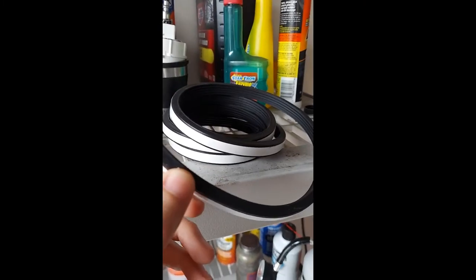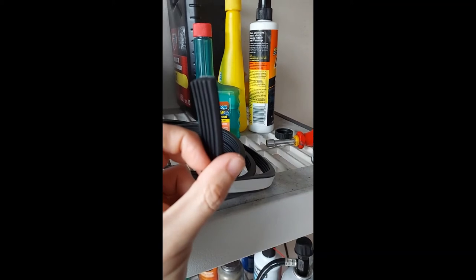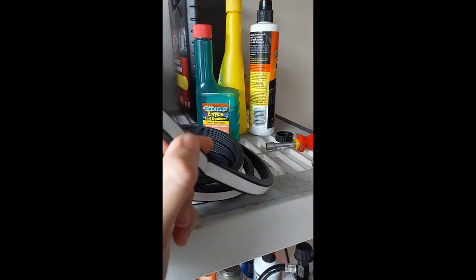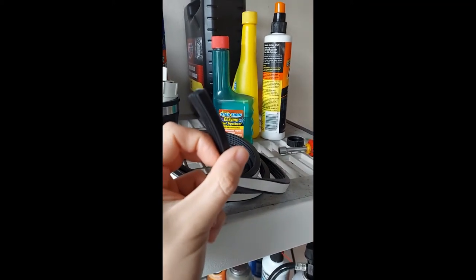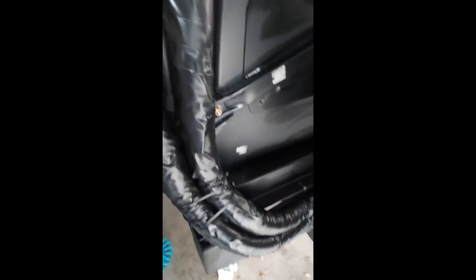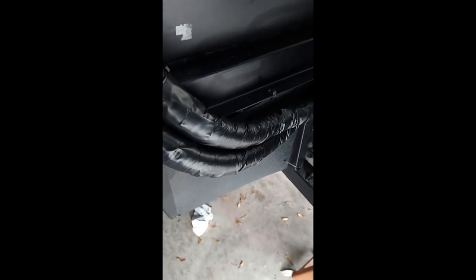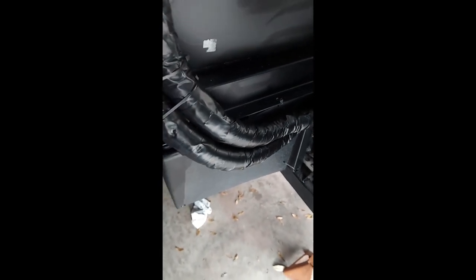For the air box, this is the rubber seal I used — just like a garage door seal, I believe it's 17/32nds. Sticky side going inside towards your air filter. I did go ahead and wrap the intake side in duct tape and the exhaust, just because this is going to be exposed to mud, water, everything right here. This keeps it just an extra layer of protection for your hoses.